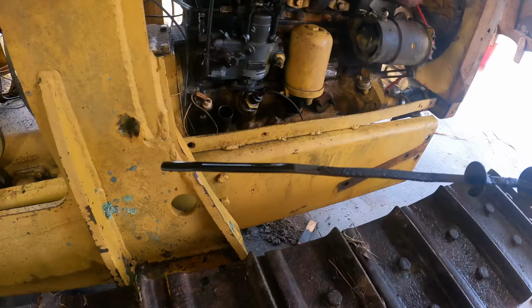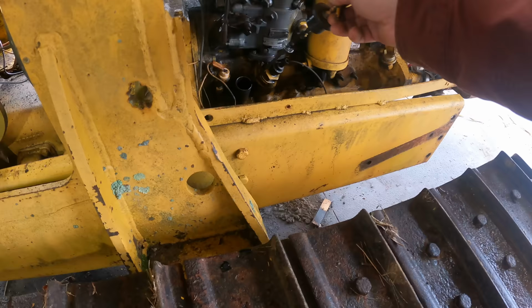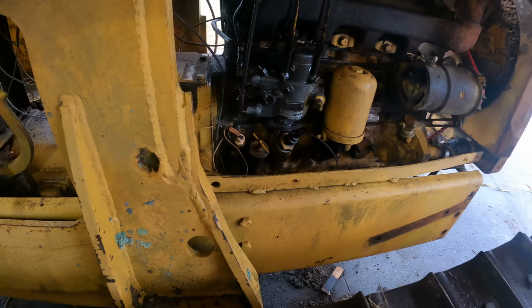And I haven't done anything to lower the oil, so this thing's burning it. Pretty sure it's burning it when I try to turn the engine off and it won't turn off, it just keeps running. But also it's burning it while the engine's running. Mostly out of cylinder four, I think, because its oil ring is gone. It may very well be gone. It might be broken sitting in the bottom of the oil pan.